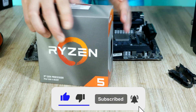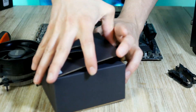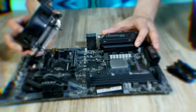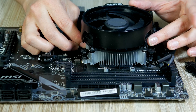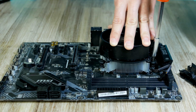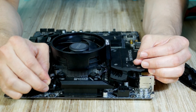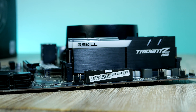Next up, let's go ahead and get the CPU cooler ready for installation. The installation process is easy — all you basically need to do is position the CPU heatsink so that the AMD logo is facing the same direction as the Tomahawk heatsink. Make sure that the four spring screws are aligned with the screw holes on the back plate, then carefully tighten the cooler down in a cross pattern until you feel resistance. Take the CPU fan cable and plug it into the CPU fan header on the motherboard.